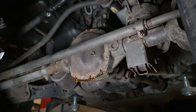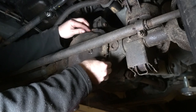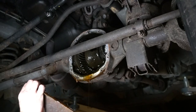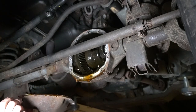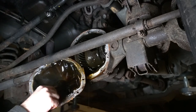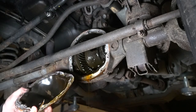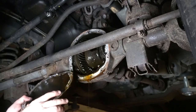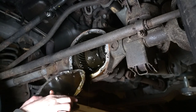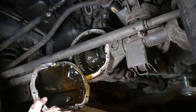It's from Harbor Freight — it shouldn't do that. No glitter came out, that's good. Little Dana 30 with the Quadra-Drive axle, looks pretty decent so far. We've got our magnet with nothing on it at all — which again means this thing was recently serviced. There's hardly anything on it, no metal flakes. There's your little magnet in the bottom.